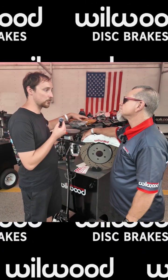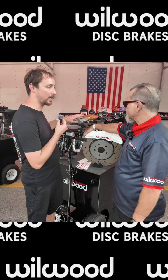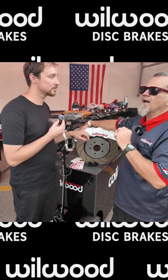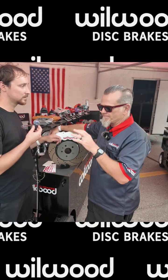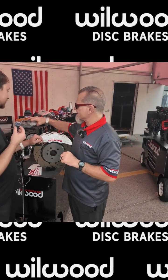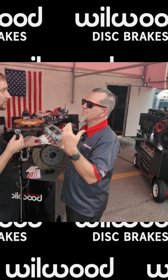This kind of style caliper is more geared toward what I'm doing with the car — autocross, road course, racing. On a street car it'd probably be okay to have something like this. So street car stuff — you're talking about hot rods, show cars, muscle cars with 15-inch wheels — that's where you're going to see more of this open bridge caliper. But they're not as concerned about that repeatability like you're going to need in your car.